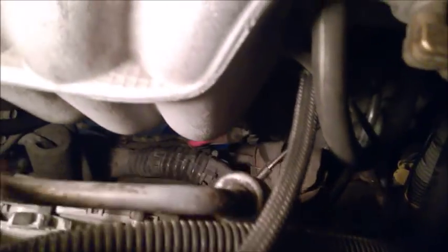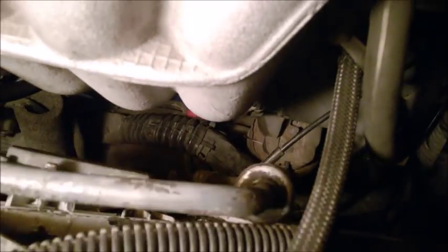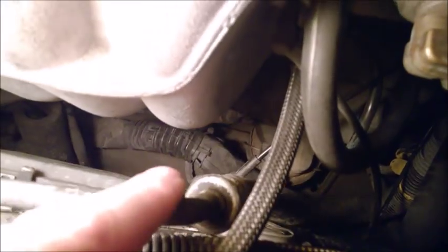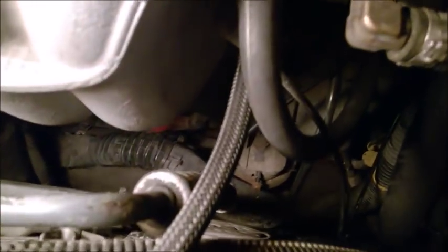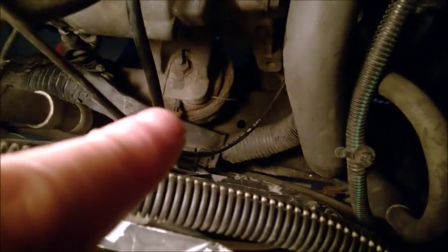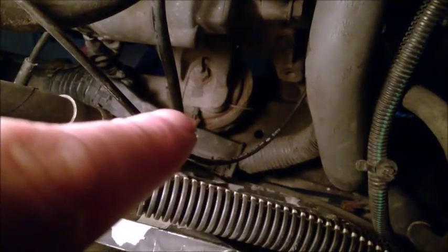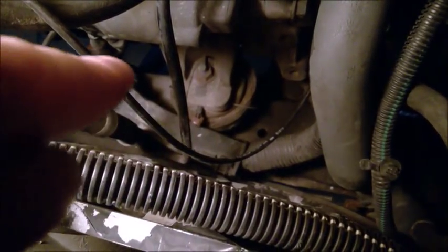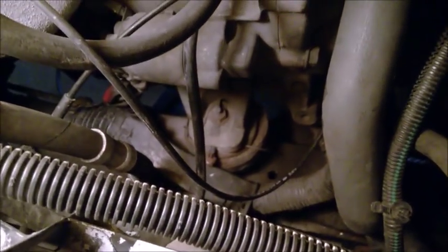Also, we have this cable, whatever its name is. It's also attached to the subframe, and it's also keeping the subframe from dropping and putting stress on the cable. Its bolt is right here on the engine. You see I put the bolt back in place without it being attached. So detach that bolt right there. It's a 10 millimeter also. This one is easier to reach.